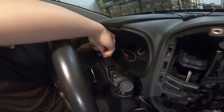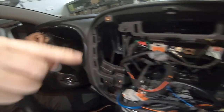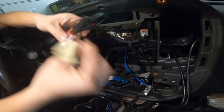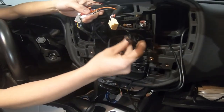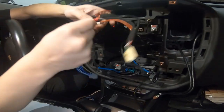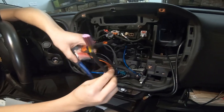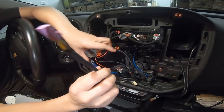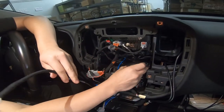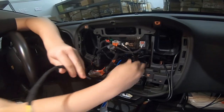Unplug it and put this connector between it. After you have this connected, route that cable all the way to the front. Now that we have these connected, you're going to have a mini USB connector — this is for the screen. And the AC. Here's the small speaker. This small speaker is the purple connector — this is for your navigation, say Google Maps, when you want the turn-by-turn navigation to sound off and tell you directions. You can mount this anywhere using the adhesive provided.